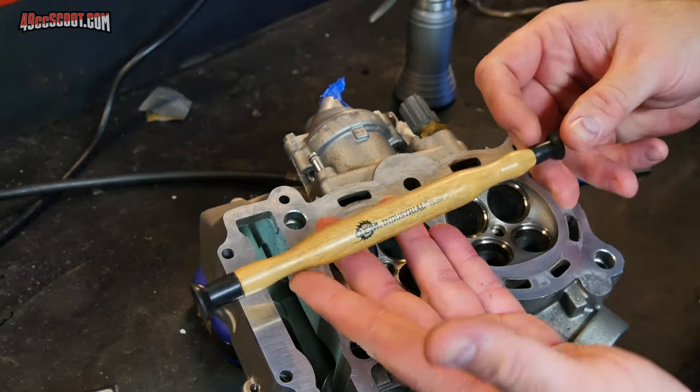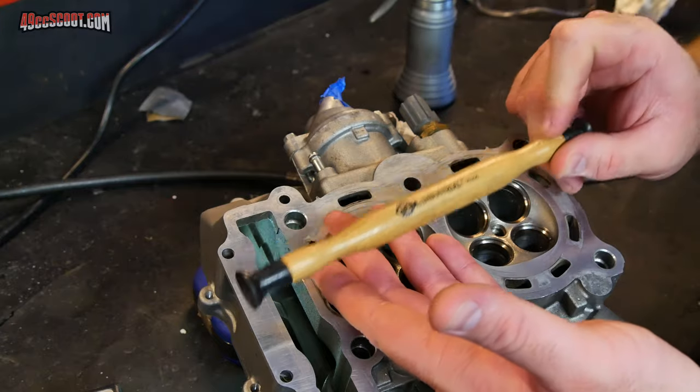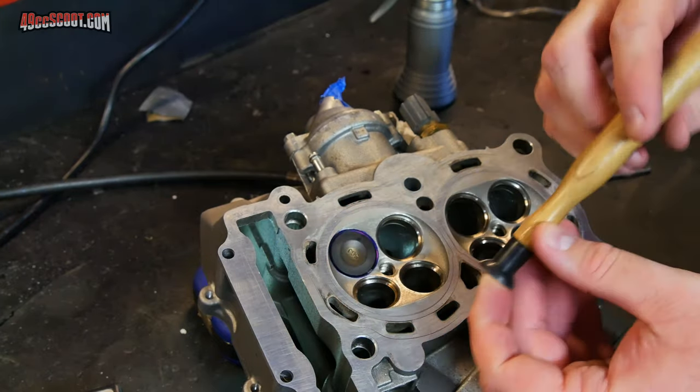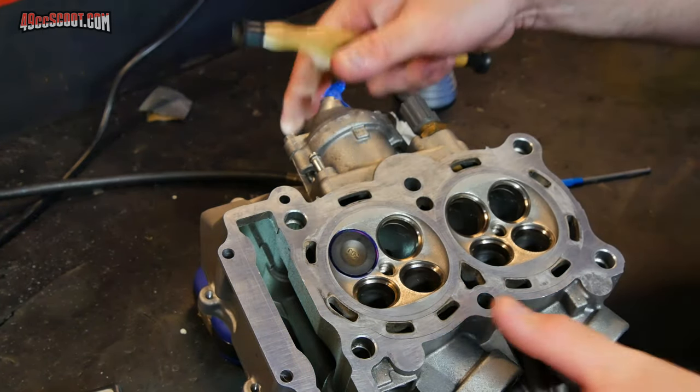Most people are going to use one of these valve lapping suction cup setups here. You can get them from pretty much any parts store. I'll try to put a link in the description too. And you'll just stick that to the face of the valve and then you can spin it around by hand. Some people like to flip the head around and get a drill in there and grab onto the other end of the valve, usually put some masking tape on it to protect the valve stem and spin it that way. But I generally use these. And you may want to, we'll say, lubricate this, moisten this up. Usually most people just put a little spit on there or a little moisture and stick that to the valve.